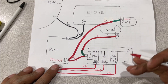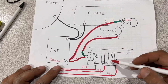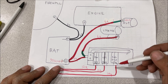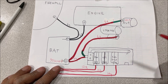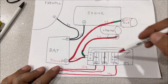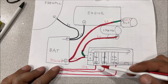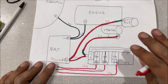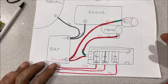For wire sizes, you have to look up wiring charts — they show the correct size wire for the run of cable. I get irritated when people say for 30 amps you need a 10-gauge wire. If you look at the chart it depends on the run of the cable. Is your chart based on 50 or 60 feet? Is it a residential wiring chart? On vehicles you'll see 30-amp fuses running 14-gauge wire because it's only three or four feet on cooling fans under the hood. Automotive wiring charts are usually based on around 10 feet.